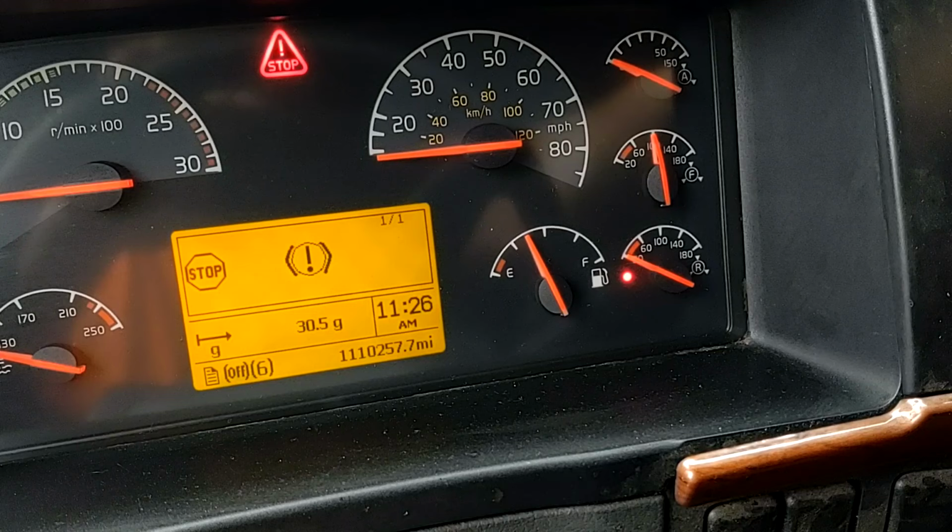In theory, we should be able to push our valve, hold it down. It should air the truck up. I'll turn the key on so that we can see the gauges come up. And that'll air the truck up. Once the truck tanks get aired up and everything, we can disconnect that hose, hook it back to the trailer, and then push that valve back in, and it should air the trailer up and release the brakes on the trailer. In theory.